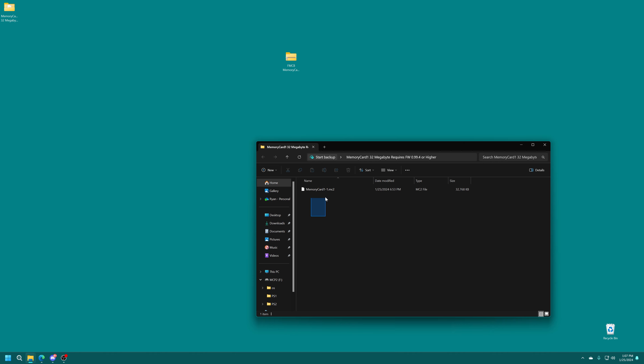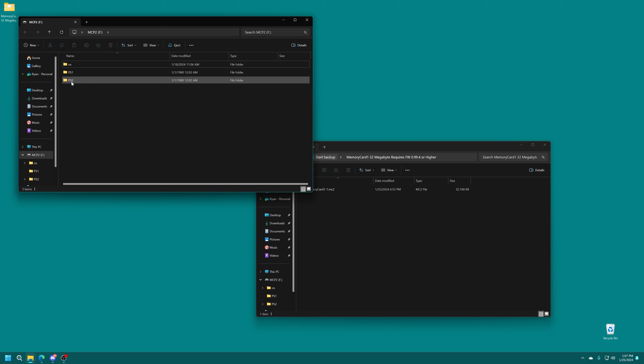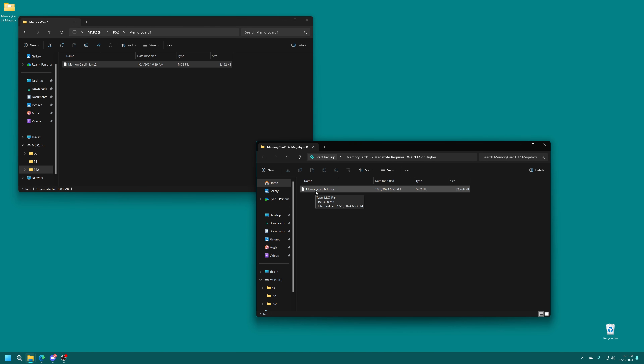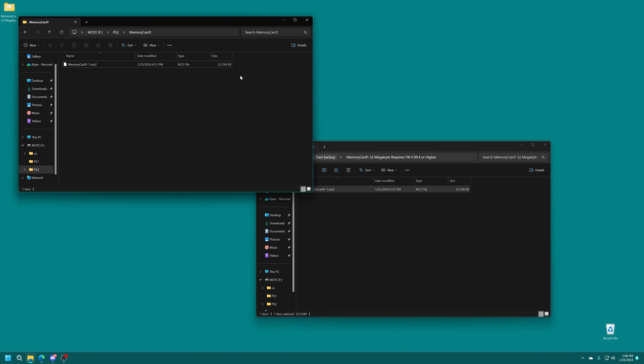The first thing we're going to do is copy the 32 megabyte pre-modded image onto our SD card. Download my Free MC Boot or FunTuna pre-modded memory card image at 32 megabytes — it just depends if you have the PS2 90,000 series or a PS2 Bravia TV whether you need FunTuna. Those aren't going to appear in this video yet as I'm still making them, but we'll grab the 32 megabyte card from the folder. Links will be in the description below. Once downloaded, go ahead and extract it.